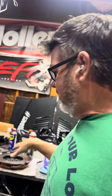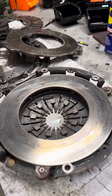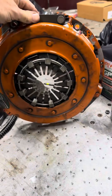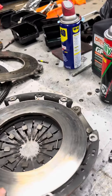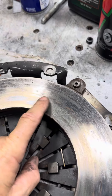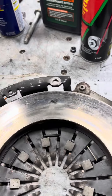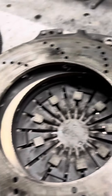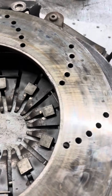Right now we're going to talk about my Centerforce Dyad and what happened to the clutch. I love the Centerforce line of clutches. This is the Dyad — it used to be really pretty until I neglected it. You can see these heat marks in it and pop marks of where it was really slipping. The floater hub looks awful. Look at that — it blew in.